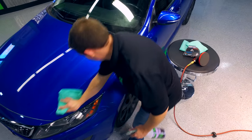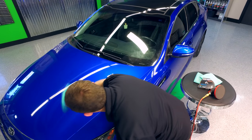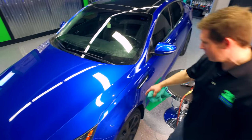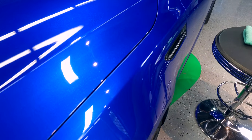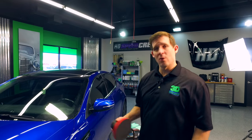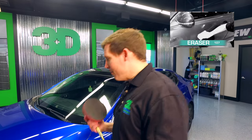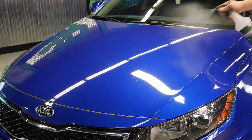Get some of the haze. As you can see, these water spots are stubborn. They're not going to be removed by just simply scrubbing them with a waterless or with any type of application — all those are still there. We're going to make quick work of these water spots. They're not too heavy, but they are enough to require a little extra elbow grease, some extra nanopad, or you can check out another segment that shows eraser gel. But because these aren't too heavy, we're going to be able to scrub these out with this nanopad, no problem.